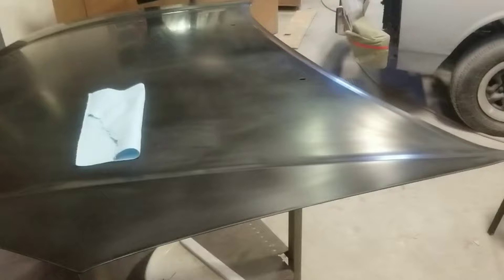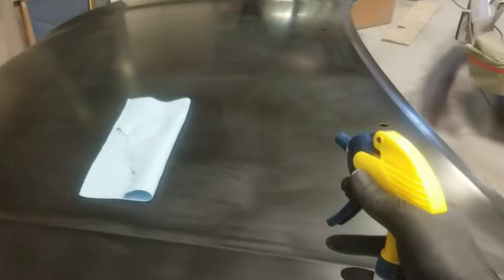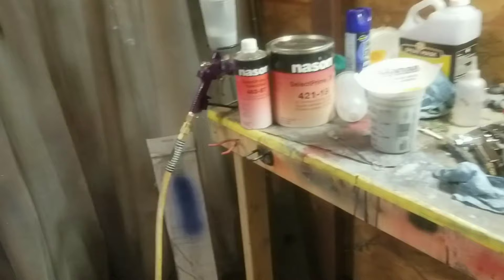I found the bottle here in this spray bottle. I'm going to spray this on and you'll see that by the time I even put the bottle down and come back, it's already evaporating. You see how quickly that evaporates? It's a highly volatile compound — a VOC — it vaporizes or turns into a gas very quickly right after you spray it on. That's why this works so well as a final prep: it evaporates off and leaves no residue. We're prepped up and ready to mix some primer.